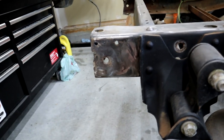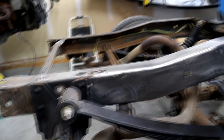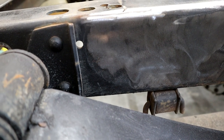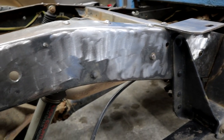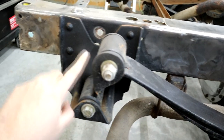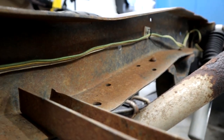I finally got this weird bumper cut off — it was welded on and bolted on and there wasn't much room to get to it, but I got it off. For the most part this frame already had a pretty tough paint or coating on it, and my wire wheel wouldn't take it off at all, so I used a paint stripping disc and a little bit of flap disc. For the most part I got the frame back here pretty stripped down to metal. Pretty soon I'm going to flip the truck around, drop the rear end, take the leaf springs out, and be able to get to this stuff a little easier. The inside of the frame I think I can just hit with a wire brush and paint over it.